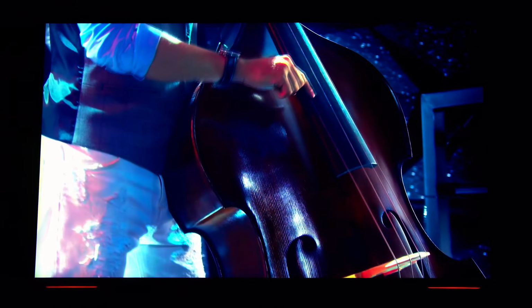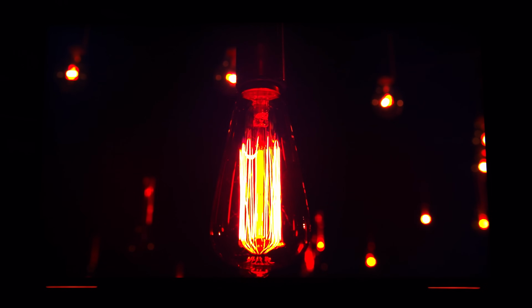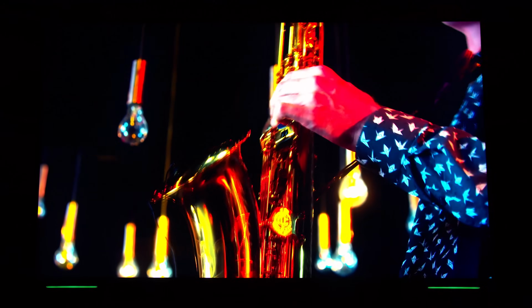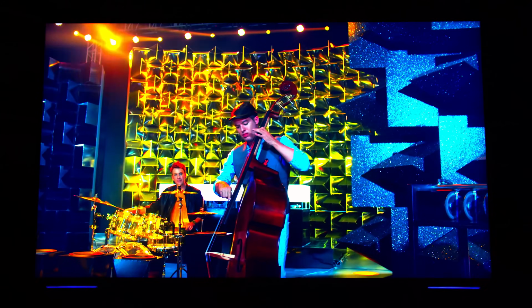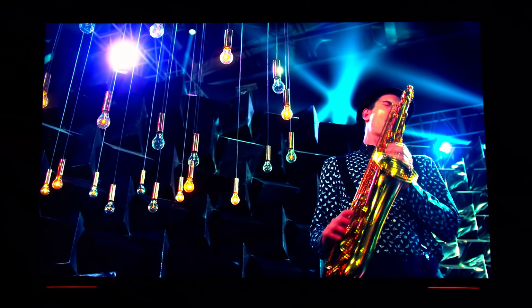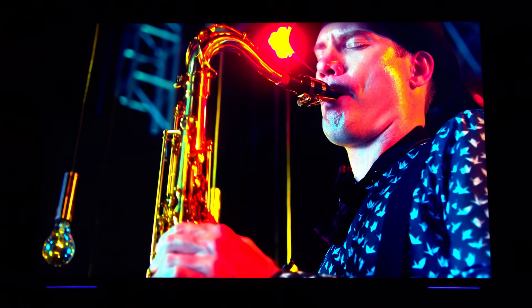Thanks to the high native contrast ratio of the panel, you'll need a big difference in brightness relatively close together to see the blooming from each zone. For a lot of typical HDR content, the FALD system here is effective and is capable of a genuine increase in dynamic range relative to an SDR screen. It's also far superior to edge-lit LCDs, which have to illuminate large sections of the display to accurately display content and often end up just turning on all the zones all the time.